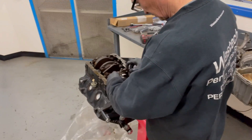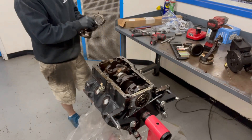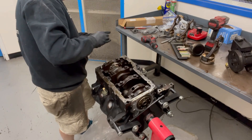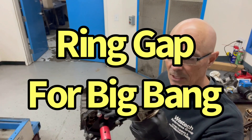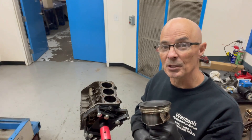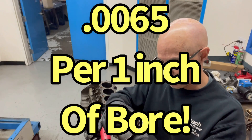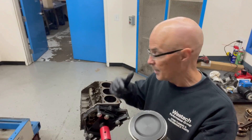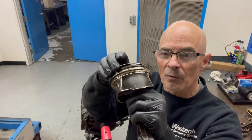These just need some ring gap. The first thing I'm going to do is put ring gap in this as part of our prep to do a big bang. Before I send it over to the machine shop to have the deck surfaced, I'll take the rings off this piston, put it in the bore, and find out how much ring gap we have stock and how far we have to modify it. Rule of thumb: six and a half thousandths per inch of bore, so we'll calculate that out and measure the bore. I've got a ring filing tool from the guys at Total Seal — I'll show you that in just a second. Let's pop these off, put them in, and see where we are.